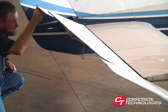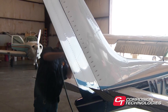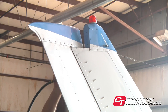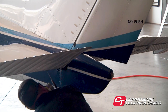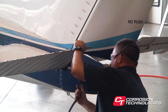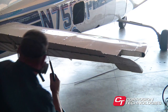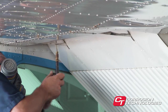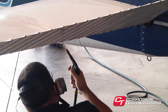Treating the tail section can sometimes be more of a challenge. Each airplane is different, but often the end cap on top of the vertical fin can be removed and the wand inserted from the top. Mooneys have very few inspection ports on the horizontal stabilizer, so some mechanics drill weep holes on the underside and use the hook wand. The hook wand fits through number 30 rivet holes and can be used to treat blind compartments that cannot be reached by the larger wands. It is also ideal to use, just as you would an aerosol can, for lubricating hinges, locks, pulleys, etc. In almost all cases, some trial and error is necessary to find the best route, wand, and application sequence.